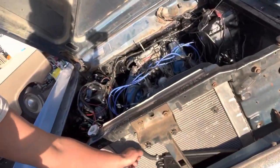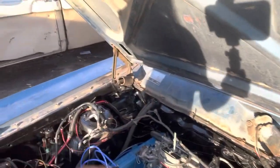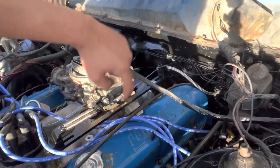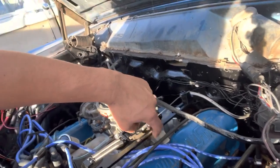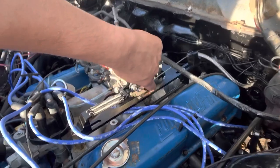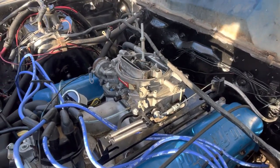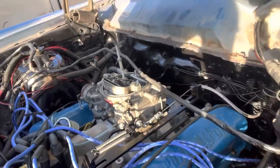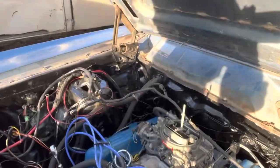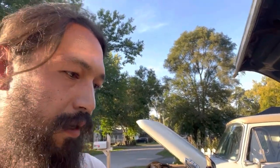It's just dangling here — that's fine, will work for now. I'm going to take off the bracket and shave this down because the little bushing on the end of this linkage is still rubbing a bit. I'm going to hack out about an eighth of an inch on the aluminum to clear the Edelbrock housing. It was working the first time I put it in but the second time I reamed it, it got a little tight and I don't want any binding on throttle linkages because nothing good happens with that.